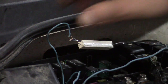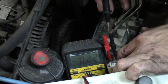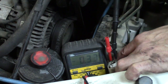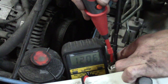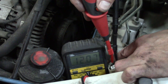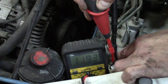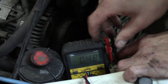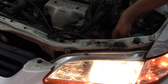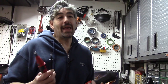So by just tracing back to find the source of voltage drop on the circuit — well, there's your problem. We got a resistor right there in the circuit. Let me go ahead and remove that and put the fuse right back in place. Let's go ahead and see if we've got a fix now. We're going to do our voltage drop as before. We know we're going to see 12 volts again, but is our voltage drop gone? We've got our 12 volts — let's go ahead and push our button. And we see that we only drop just a few hundredths of a volt. So we can see that our voltage drop problem is definitely fixed. If we just plug this light bulb back in, it is going to work. And there it is.